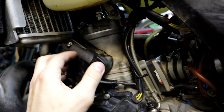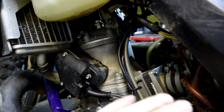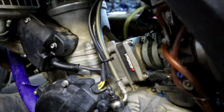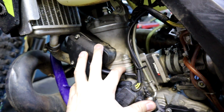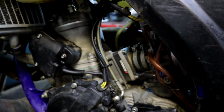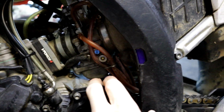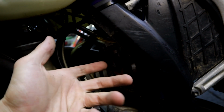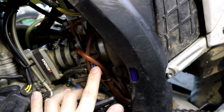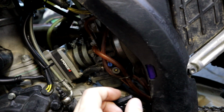Also, this small electric motor is keeping the power really smooth, really not aggressive, so it's really strange. When you start to ride the Sherco, it's really strange because this bike is too smooth. It's so easy to ride, it's not believable. Also, the carb is not easy to adjust for jetting because it's really close to the engine, so you need to remove the tank, flip the carb and change the jetting. Also, you see this blue screw. It's a really good modification for the bike. I got this to adjust the air mixture by hand.